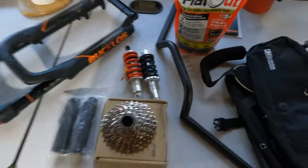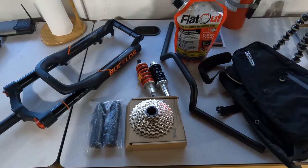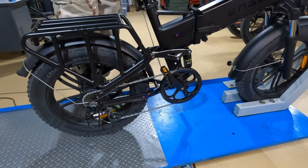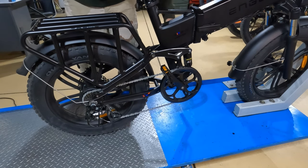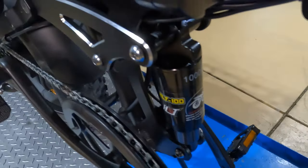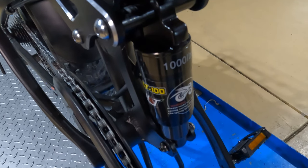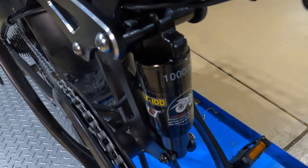There's just no way around it. Once all these parts are on, it should really transform the bike into a very smooth commuter and make it a more fun bike to ride. At 190 pounds, I can just barely move the rear suspension. The shock spring is just way too heavy. The shock on the bike has a 1,000 pound spring in it, which is too heavy for the geometry of the rear suspension. We're going to replace that with a shock that has either a 500 or 650 pound spring, which will also be adjustable so we can raise the preload if needed.